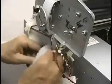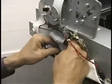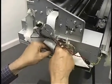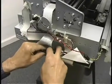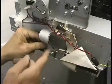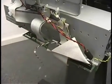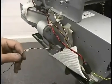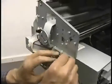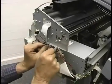Now putting this back in the ZIF, zero insertion force connectors, is just the opposite of taking it out. We're going to cautiously put it in there with these loose till they bottom out, and then push down on these, and that wedges them in place, and then they're quite stable. There's red lines on here that'll help you see if they're not in there squarely. They've got to be in square, or you're probably not going to have a good connection, and you'll come up with a 1111 error, meaning that the printer doesn't like the way its trailing cables are plugged in.